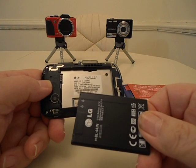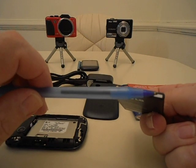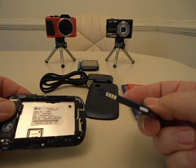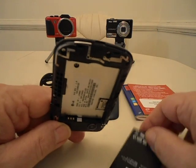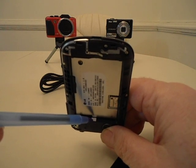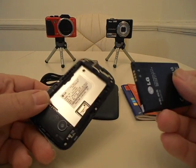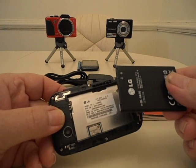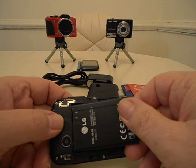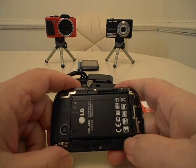That little white spot on the battery is a water damage indicator — if you have water damage, it'll change different colors. You've also got on the inside of the phone casing itself three pickups, and another little white spot — same thing, it indicates water damage. So if you take it in for a warranty, they're going to say you dropped it in water, so it's no good. You take your battery and just put it in there where those contacts line up, and it just snaps in place.